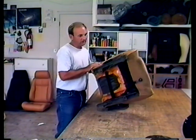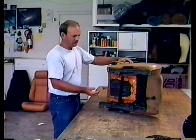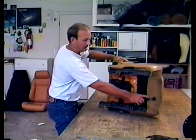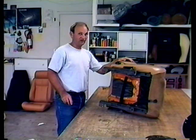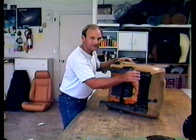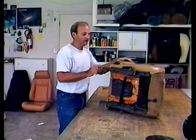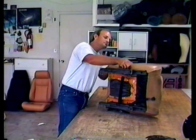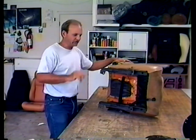If you're working with the seat and carrying it around, or you start doing what I'm going to show you, and you were to accidentally touch the actuator, that's going to pop back on you and it's got to hurt. So slide the seat all the way forward in the car, then take the back ones out, then remove it from the car. As soon as you get it out of the car, remove this spring. Now you won't hurt yourself.